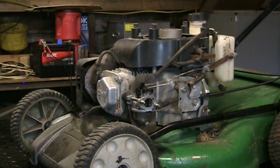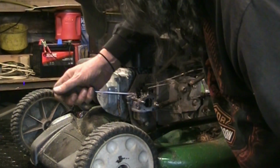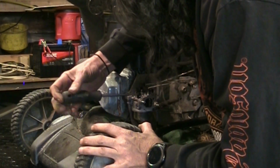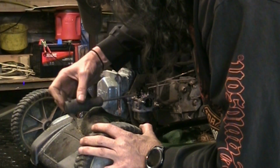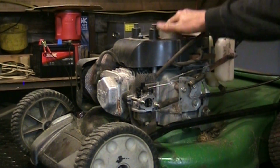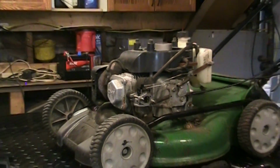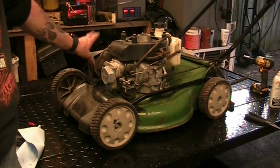All right. That is that. Yeah, she might be okay. She might run. Maybe. We can hope. We'll move some stuff around, and I'll use a drill to give her a spin, and we'll see if it fires at least. We'll drop the table down and clear it off so stuff doesn't rattle off the bench and fly all over the floor. Okay, so I had tested the spark plug for spark earlier and it was fine.